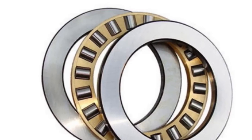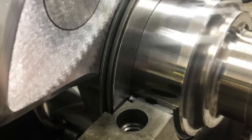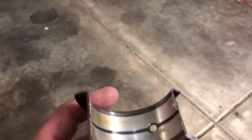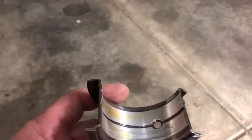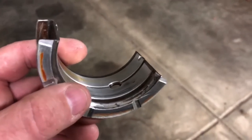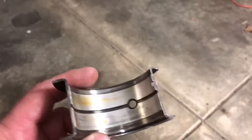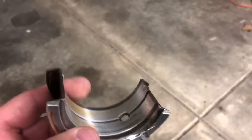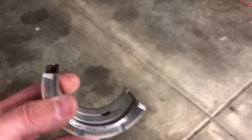This is what the roller thrust bearing looks like. When they machine the crankshaft and the block, it fits in that gap and you adjust it with shims. Converter technology has come a long ways — being able to have a torque converter that is very loose to spool up, or using dump valves, and then being tight enough down track. Back in the day we really struggled with torque converters; if we got it loose enough to spool up quickly, it would blow through on the top end and we couldn't get mile-per-hour ET out the back. A lot of stuff has changed over the years.